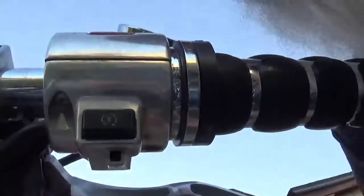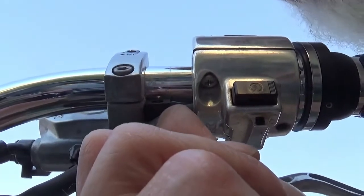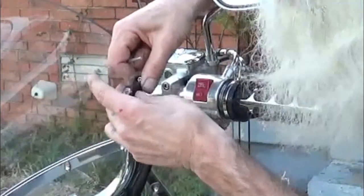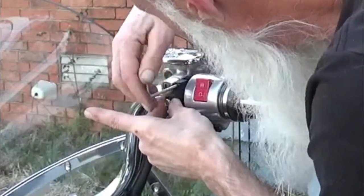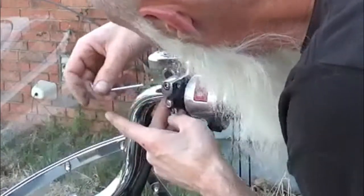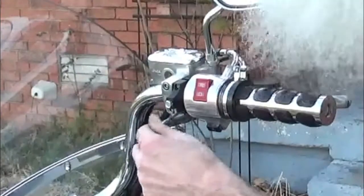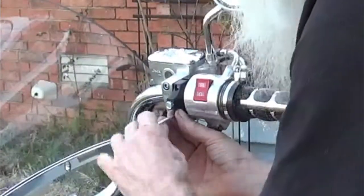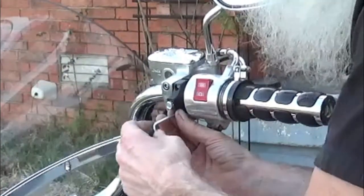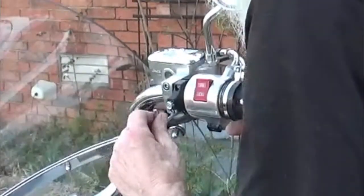When you look underneath, this line right here — I wish I had better lighting — was kind of interfering, so I'm going to get everything started and then move everything around so that it fits. When I hold this, I usually put a finger over that one hole so that screw doesn't come out. Put the Allen key in, get the top one started — just enough to hold it in place — then start the bottom one. I recommend you start just a couple threads each. If one goes in sideways, or one side is uneven with the other, you'll cross-thread something and it's not going to go together, and your small project may become a bigger project. With any project, allow yourself a ton of time because once in a while you won't have an Allen key, you'll have a wire loom in the way, or you won't have the right tools.